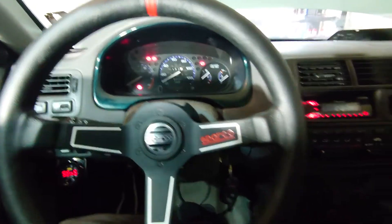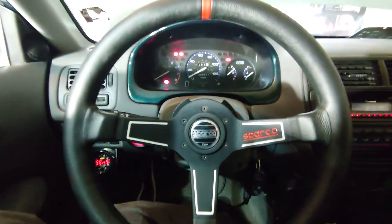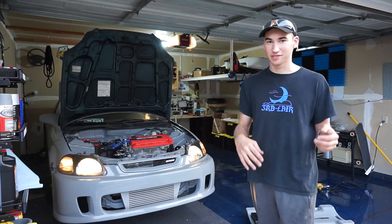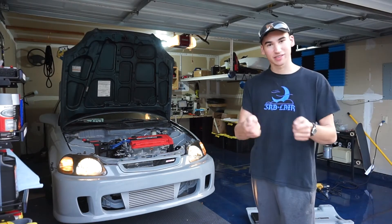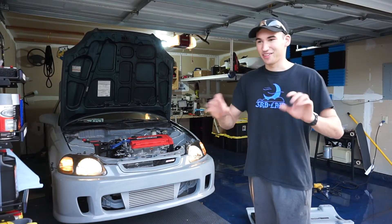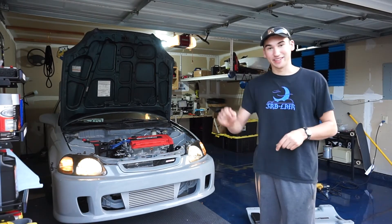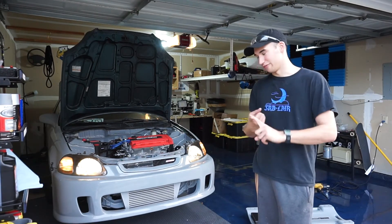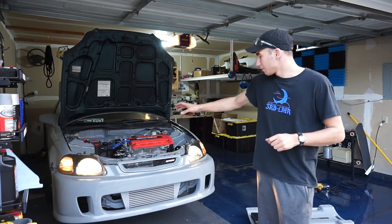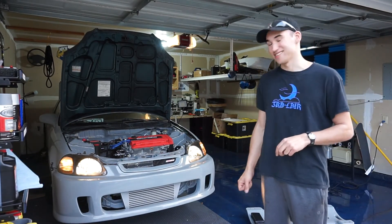That's all the wiring for today. Obviously I've got to clean stuff up. Thank you again for tuning into Crafting Cars. That harness is pretty easy to install — just had to move a couple things around, and as you can see, everything just kind of clicks into place. It's super exciting to see the Civic finally having power — all the gauges lighting up, headlights turning on and everything. It's going to be less than a week before I'm turning that key. Just got to run the fluids, do a quick valve lash adjustment, and finish up the intercooler piping and hoses. I'll see you next time. Bye!